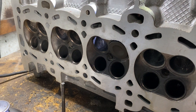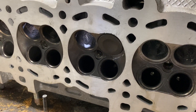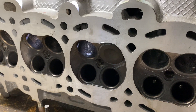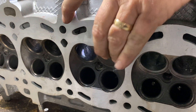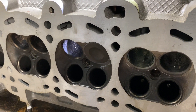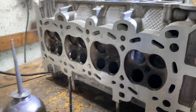You don't go too fast because all the compound is going to fly off and defeat the purpose. You go with light pressure with a drill, about 20 times — count them all the way to 20. Then you reverse it. As you do that, you're pushing out a little bit, applying pressure, then no pressure, pressure, no pressure. You may have to do it a couple of times until you get a nice tight seal.